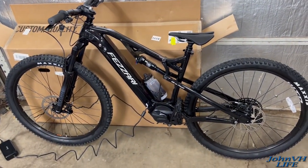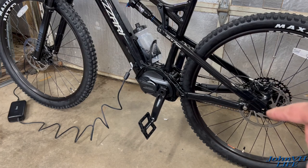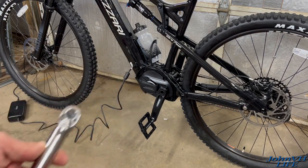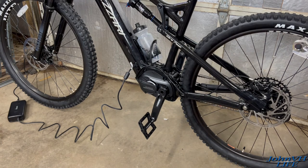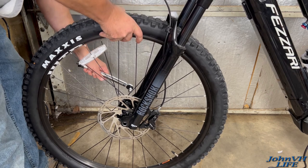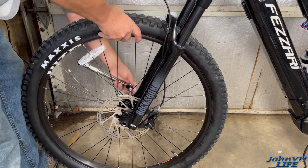So excited, I cannot wait. The caps say on them what they are — it's like 10 Newton meters for that one, and the other one said 9 to 13 and a half, but it gave inch-pounds which was 80 to about 130. I've got my inch-pound torque wrench, I'm going to torque them to 90 for now and see how that works out. We're right there. Now I'll do the front wheel — that fits this one. And we're good, we're already there.